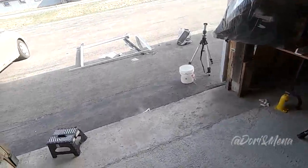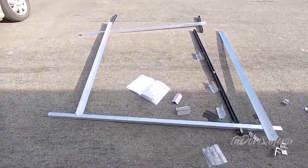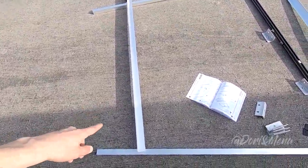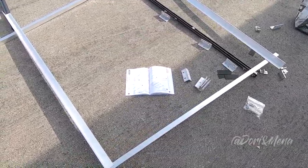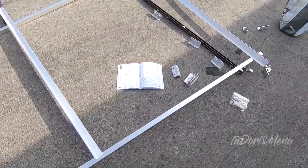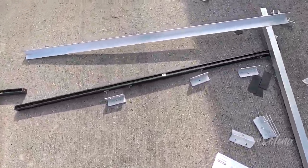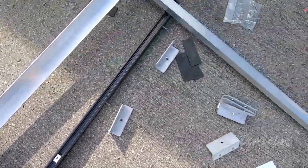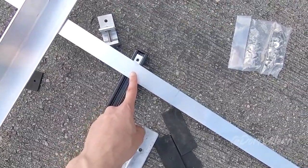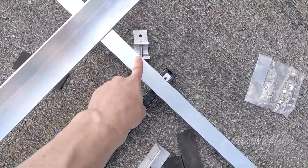Our next step is working on the solar rack. So we're also using aluminum L bars and tubes, but they're a little bit bigger and thicker because it's the roof. And these things we ended up buying locally. So these rails are the ones that are gonna attach to the van. The tube's gonna attach to this railing and the L bar is gonna attach to the tube.